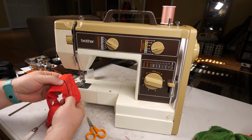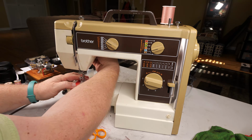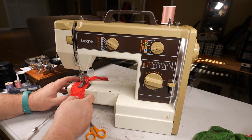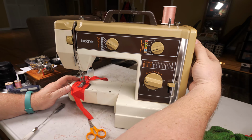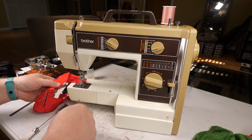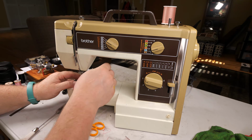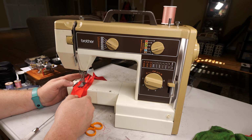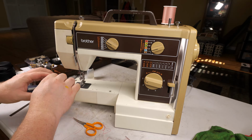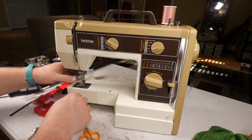There we go. The bobbin is pulling the upper thread through, so we can set the machine up, the tension up to say 5.5, and that should... it's still pulling a bit too much through the bottom. All right. Okay, I overshot that bobbin tension. We'll turn that dial back.